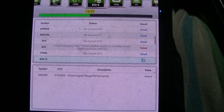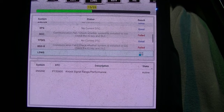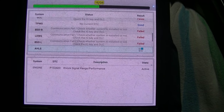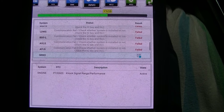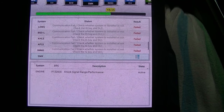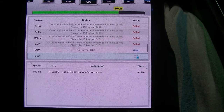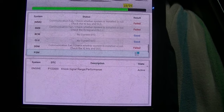Looks like we have our P1326 and that's probably going to be it. We might have some silly stuff in history — there's usually history codes on almost any car I scan, whether it be low battery voltage codes if the battery's ever died or simple stuff like that. But it's good to get the full picture, especially on these modern cars that have 15 to 20 modules in them. You want to know if everything can talk to each other and if any of the modules are ratting any other modules out — that's why you want to get a full workup on the car.